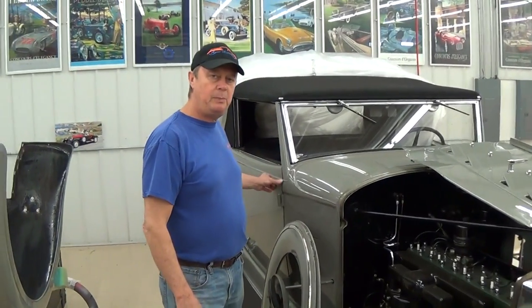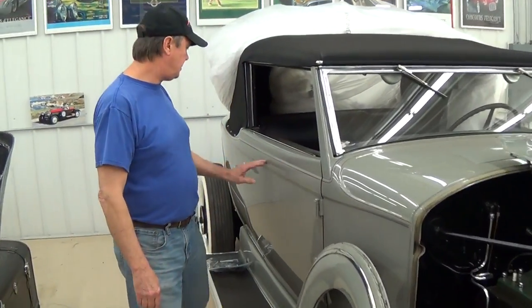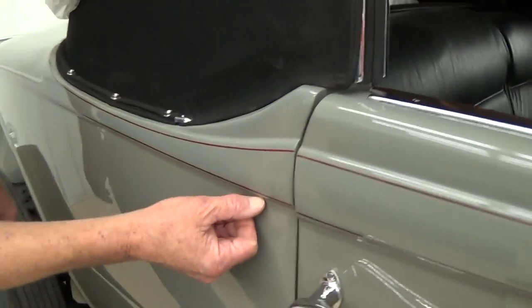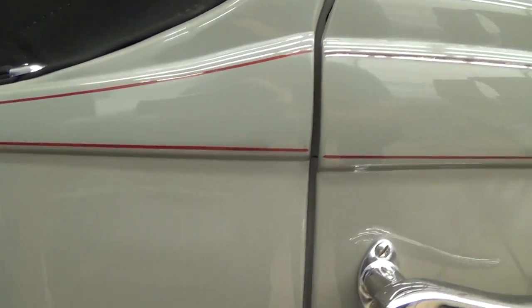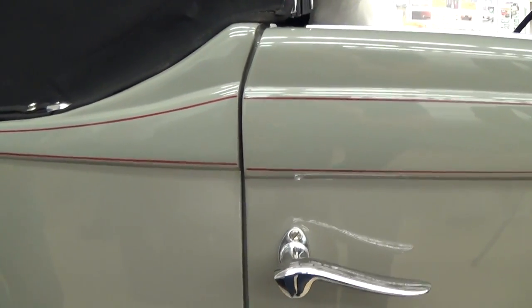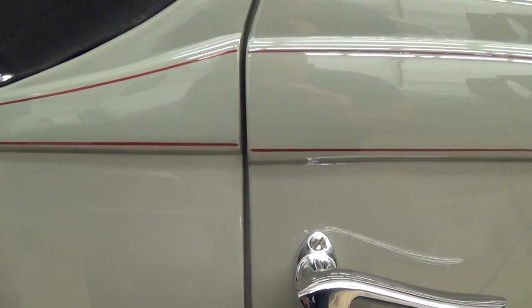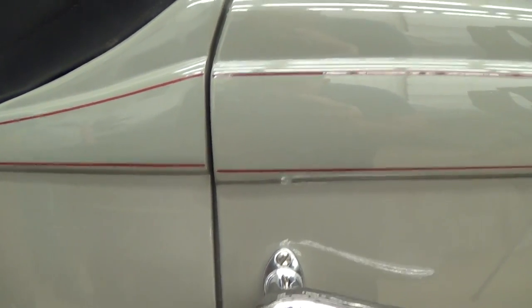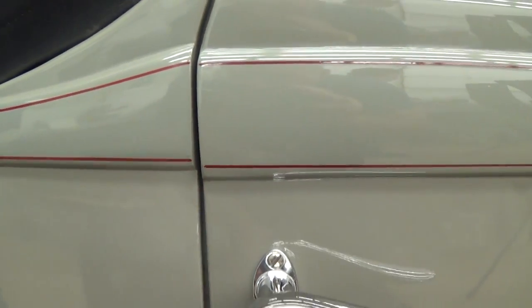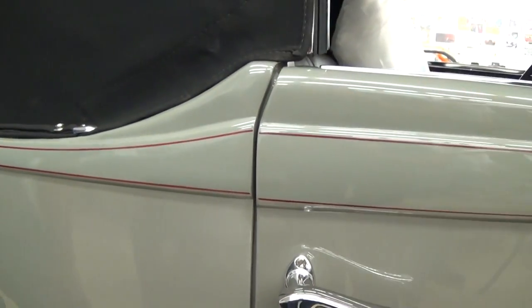That's all the fit of the panels — they don't fit really flush. There's some misfitting in the door, about a quarter inch of drop there. We have to shim the body to get the doors lined up right. Whoever put the car together just wasn't really thorough about it. You're talking about how this body line has dropped down right there, and the door — it doesn't even look like it's fully closed.